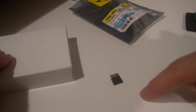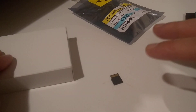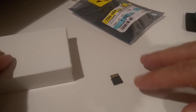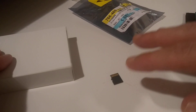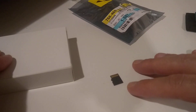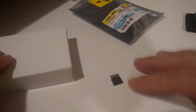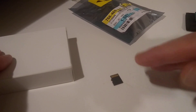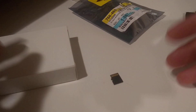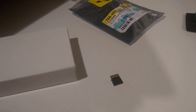That I have here. SD card — does not need to be that large, I have a 2 or 4 GB partition. What you do is, you download some files in a zip folder, unzip a directory to this card, or whatever card you have, that are FAT32 formatted. Insert it in the Raspberry Pi. And I installed the things in the Amiga — there.